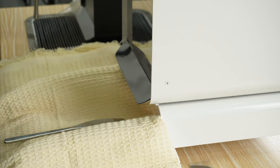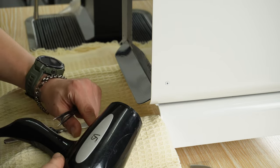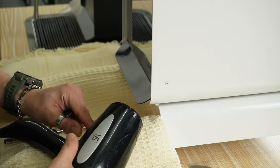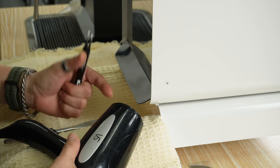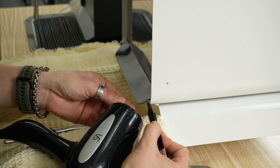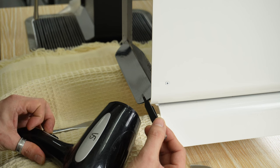We're about to start. Luckily the leg is providing a good leverage space for it to blow the hot air in between the mirror lip itself and the front plate lip. I'm just going to easily wedge my little pair of tweezers inside here and I'm going to start the heating process now.